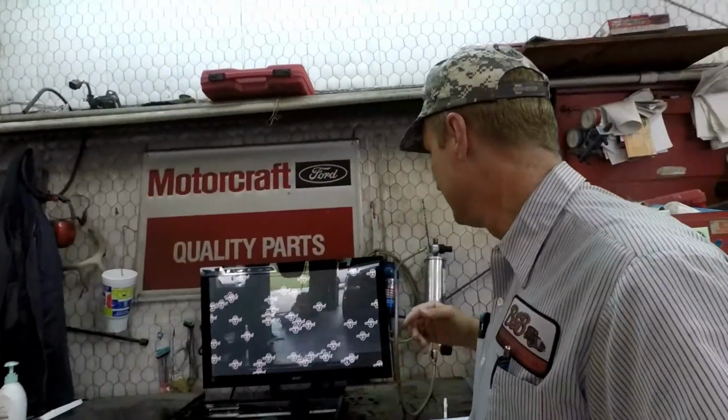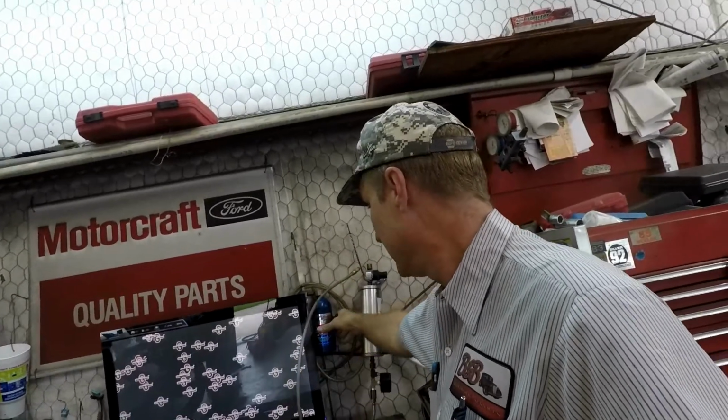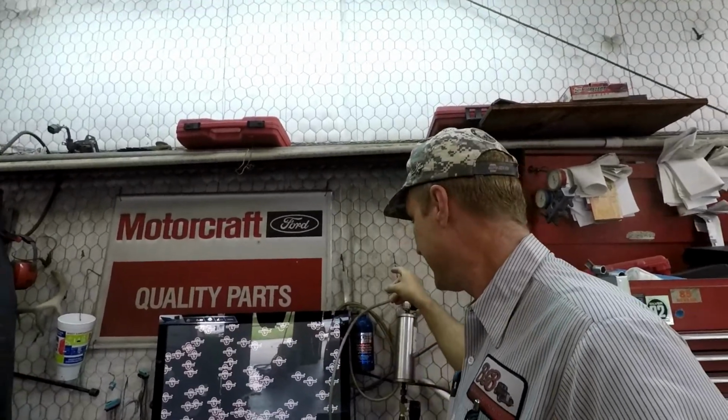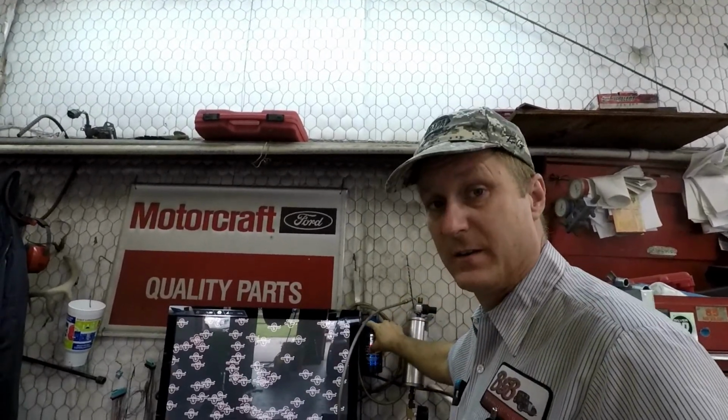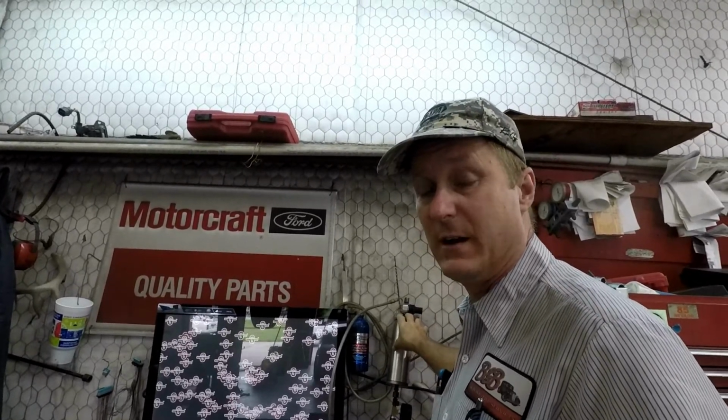Some of the tools we use, basically have a fogger, an injector cleaner, and also an induction intake decarbon tank. You put the chemical inside. This one's pressurized, so you can do injectors and or a fog. This one right here uses the engine vacuum to actually draw the material through the intake manifold, down across the valves, everything, all the way through, and clean everything up.